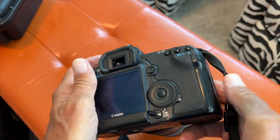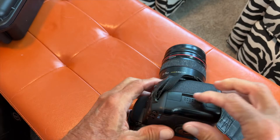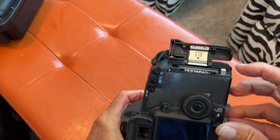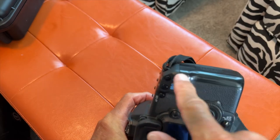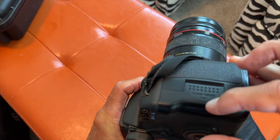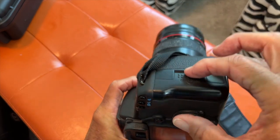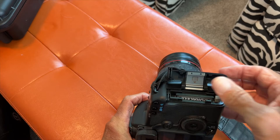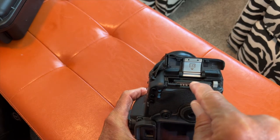I'm going to show you how you get the card out. You're going to notice that this camera has a little bit bigger card than what you're used to. You have to open up this side here. This is a CF card. It says 'card open,' so what I do is push this towards this way, and that just pops up. Then you'll see the CF card right there.